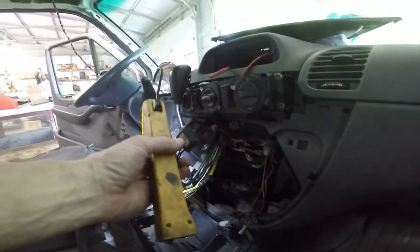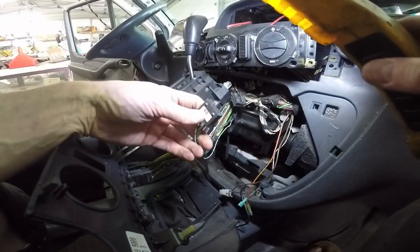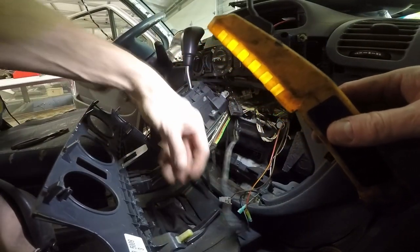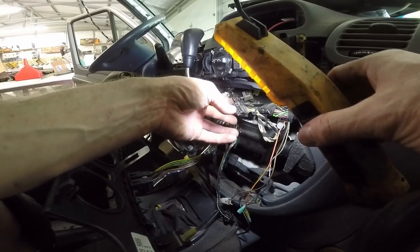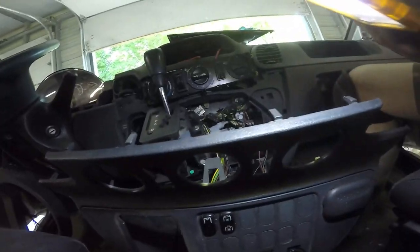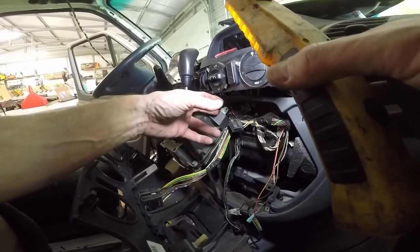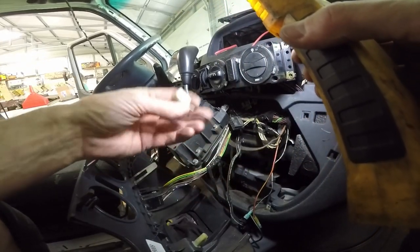I'm looking for a hot wire now for the radio. While I'm in here, maybe you guys can help me out — this wasn't hooked to anything, it's got a '48' on it and it's the same type of connection as these others. This also wasn't connected to anything. I was touching some stuff with my test light and it clicked the door locks, so I think this goes to a door lock switch — mine didn't come with a door lock switch inside. I don't know what this other one is; it's been cut. If you guys know what these are, I'd appreciate you letting me know.